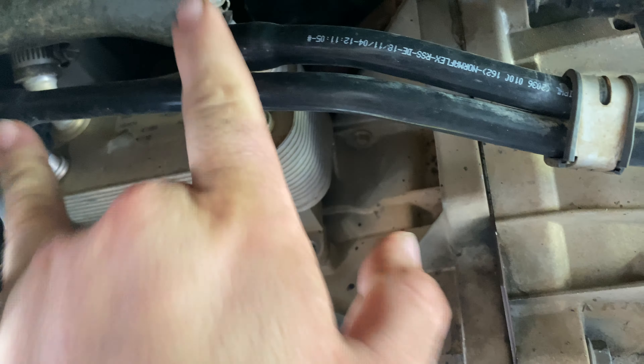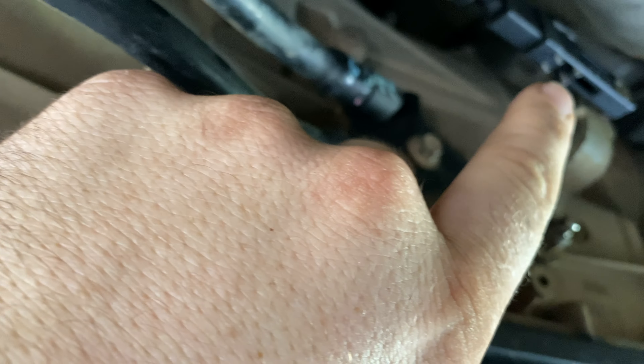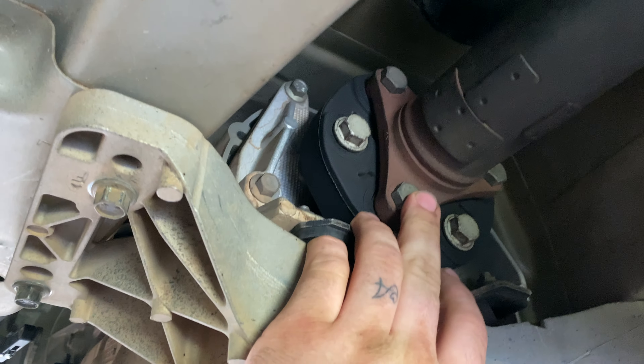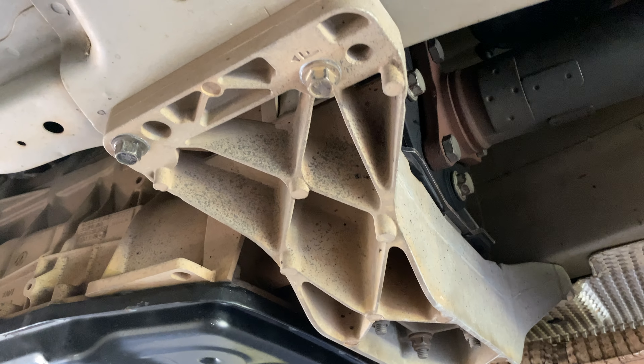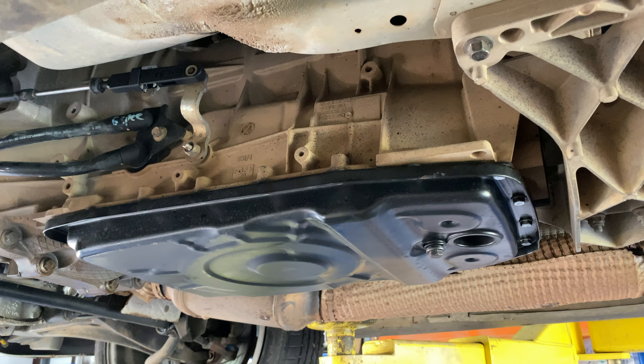It's pretty simple with these actually. Basically take the battery off, disconnect it. On this side just there, two bolts on the starter motor — you can just let it hang. Drop those two pipes off, take that 10mm out and pull the pipes out. Pop the clip there on the selector, pop it off, then you've got your connector there which you do once you pull the pan off. You've got the tail shaft — both ends and the center have to be undone, then unbolt it at the diff. Six or seven bell housing bolts, pretty easy to get to. Pop the little cover off, undo your torque converter bolts, undo your two gearbox bolts on either side, drop the cross member with the gearbox jack underneath — and voila, straight out on the ground.